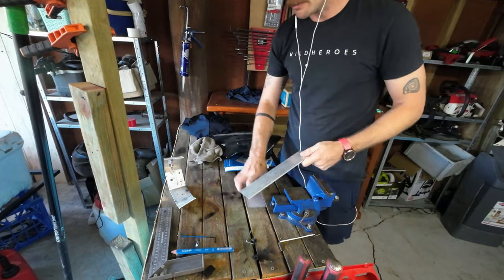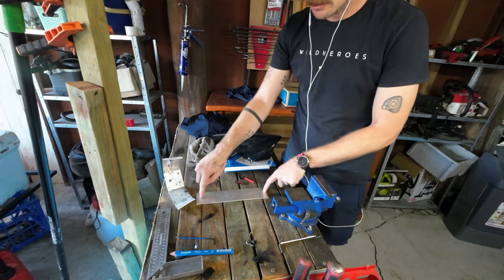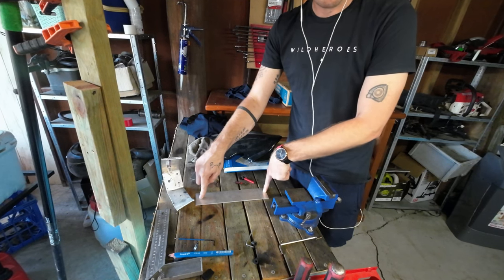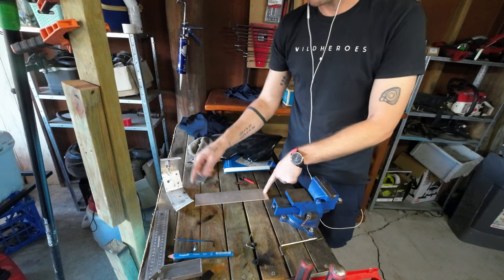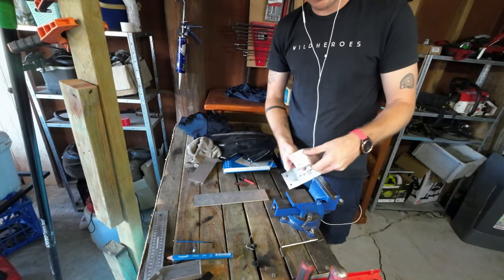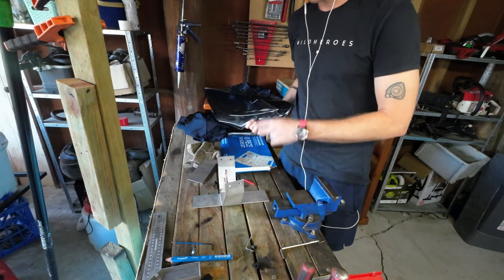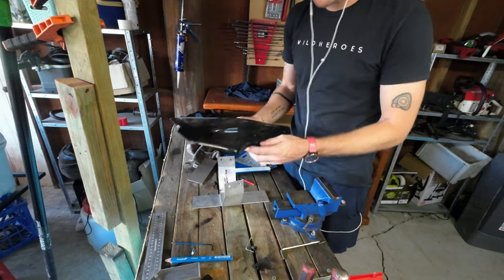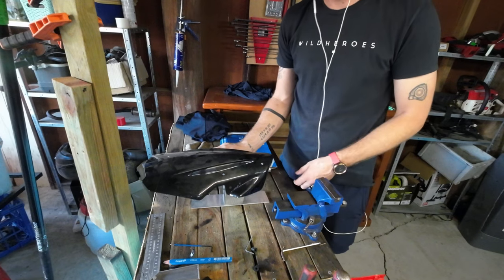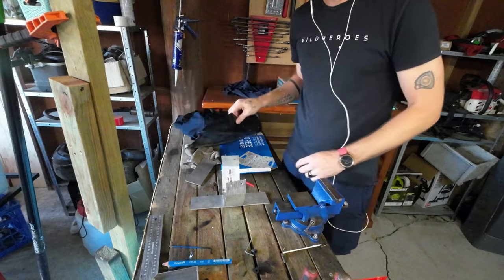All we basically do is start with our core fluted aluminium, and you'll want to find a couple of mounts to mount that to your triple trees on your forks. All forks have some form of bolt holes on them, and you might need a little bit of angle or something to pick them up. From there, literally in the vice, I just put this in and bent it up to the right shape that I wanted, bolt it straight to the side, bolt my headlights or spotlights to that, and then this just fits straight over and bolts on. And that's a rally fairing.